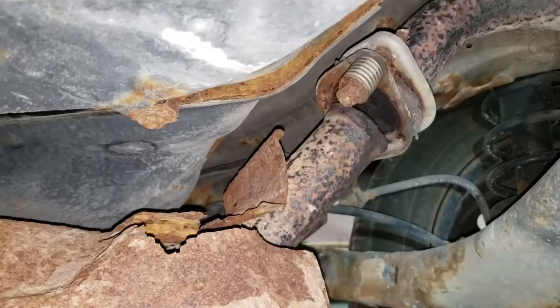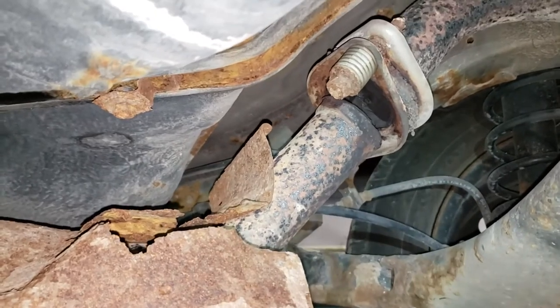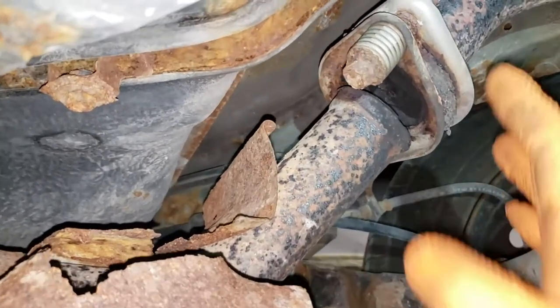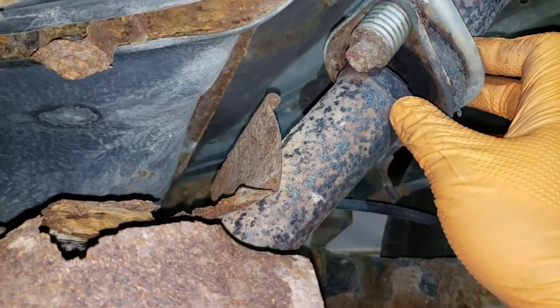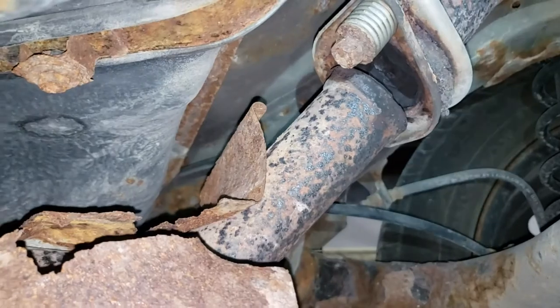Now follow the same method for all the other pieces of wire that are attached to your vehicle. Now, of course, you may be able to tackle the heat shield job at home in the driveway. It will be a pain because you gotta crawl all underneath the car, which isn't fun. But with regards to this guy here, this is something that you might not be able to. You're going to require, of course, a pipe bender or swedger, something to expand the pipe, as well as a welder so you can mend the two pieces together.